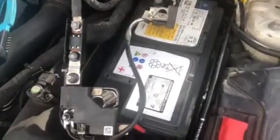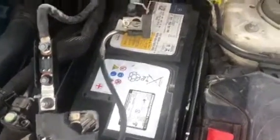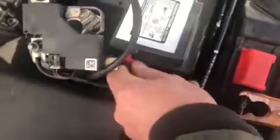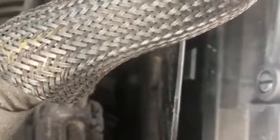I don't think they're in any immediate danger of them touching. They've designed them so they're not long enough. And there's a vent here just to remove. And there's a bolt, so you can see it, just down there. Just see it. I'm going to have to take that out. You're going to need a 14mm socket and a good long extension.